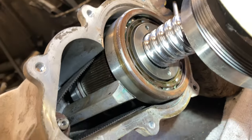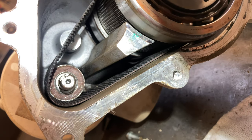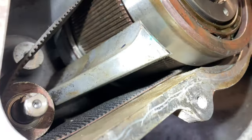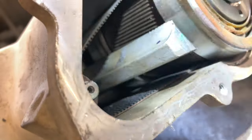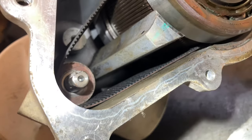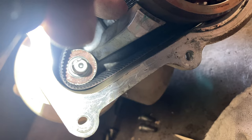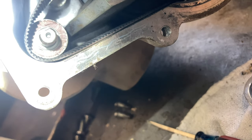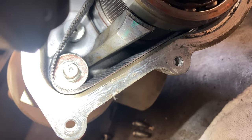I've got everything cleaned up and it is a tight, tight fit. There's a flange on both sides of the gear on the motor and it barely makes it around. You've got to run the gear with the bearings on both sides — it's got a recirculating ball in there — but you've got to pull that out just a little bit to where you can get this belt to line up, because otherwise the belt is at too high of an angle and you can't get it over the drive gear on the motor. I used a piece of wood and pushed on the edge of that belt. Don't get rough with it because you'll knock the teeth off or crimp it, and then you'll need to get another $100 belt.